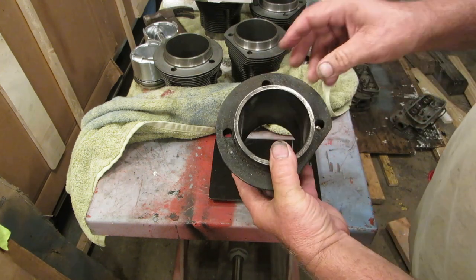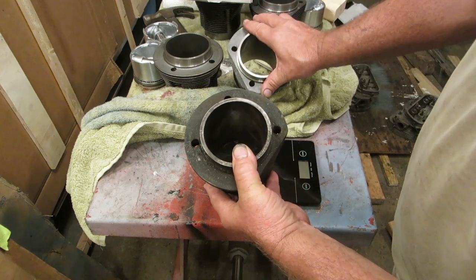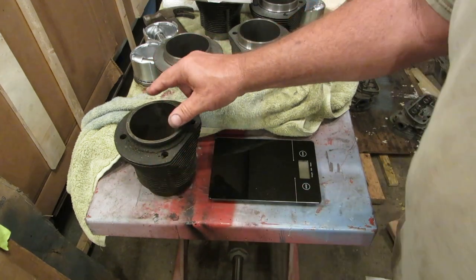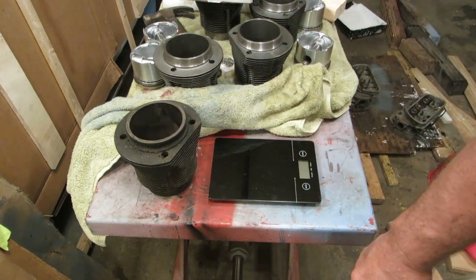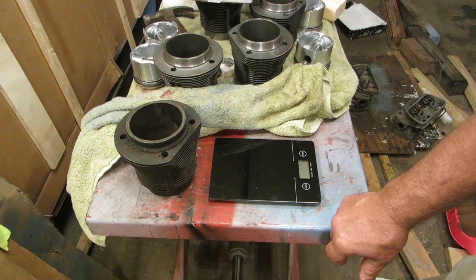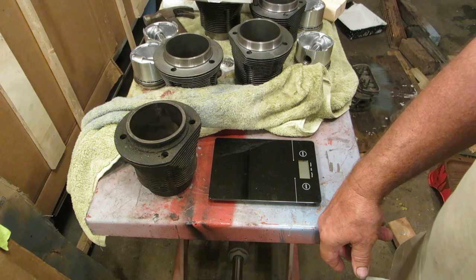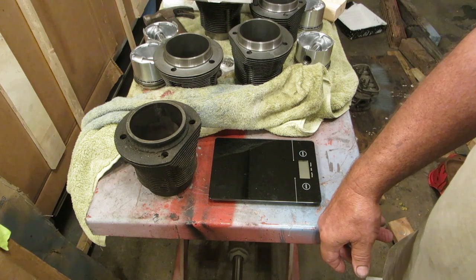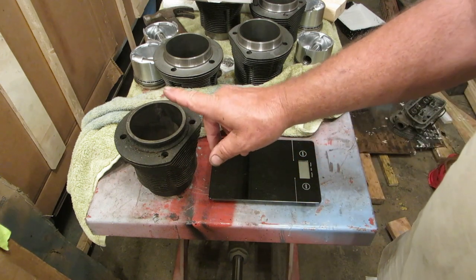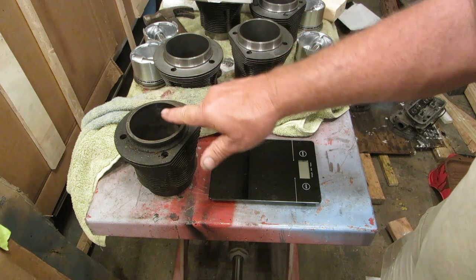Incidentally, you can see how much meat there is on the 1500 and how much on the 1600, and there's considerably more. That cylinder right there would go a couple hundred thousand miles. You could hone it and put some rings on it, and Bob's your uncle. As long as you didn't get it really hot, it'd be fine for someone who was not hot rodding, taking care of their engine, doing oil changes and stuff. That's a very good quality cylinder right there.